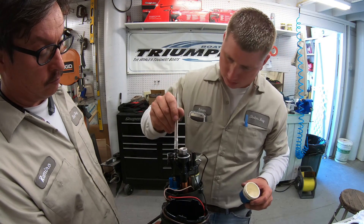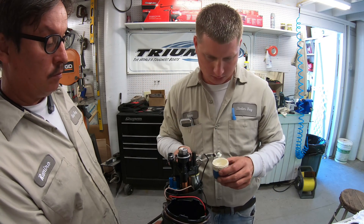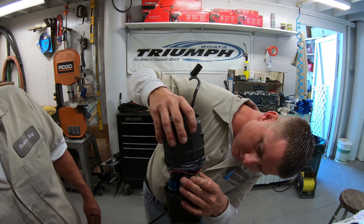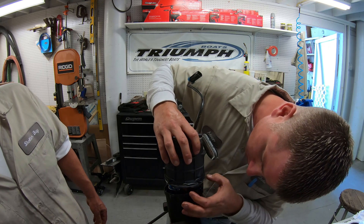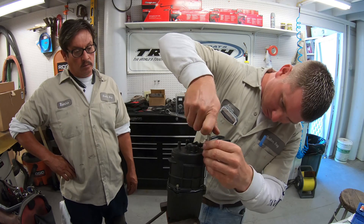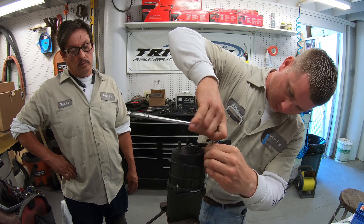Lube up the two brown o-rings on the top piece and the o-ring around the housing itself. Now hook up the fuel pump and, making sure not to catch the wires, slide the top of the housing down — this can be super tough to get to seat, but just press down until it slides. Install the four bolts, and it's time to pressure test this thing before we try installing it back onto the engine.